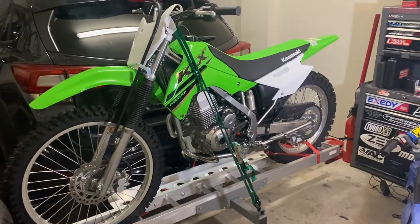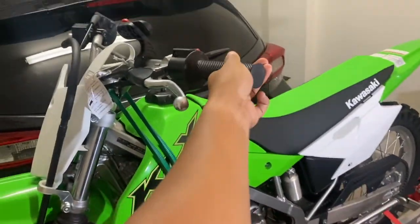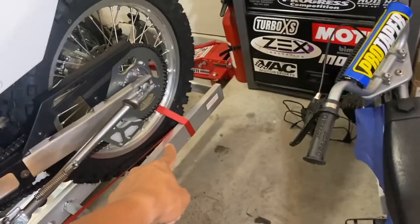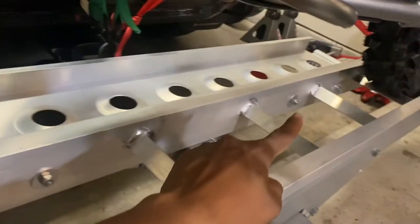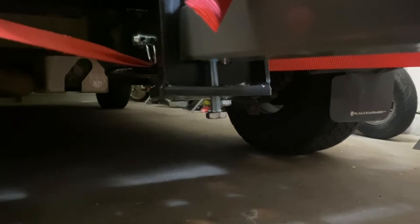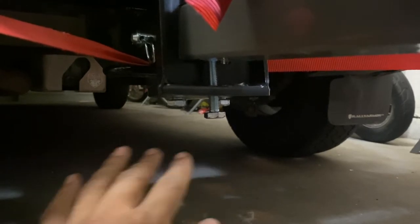Here's what it looks like with the bike strapped on. I just used a ratchet strap on each side to go around the handlebar through the factory loops on the main shaft, and it's actually been very stable. As a precaution I did an additional strap which I looped through the foot pegs and through the rear tire just to ensure the bike's not going anywhere. The ramp stores away very easily back here — I secured it in place with two bolts, one on each side, tightened with a wing nut. That black bracket you see has multiple bolts under it that you torque down fully once the carrier is fully installed; it keeps tension on the main shaft and on the trailer hitch to help reduce any wobbling or play.